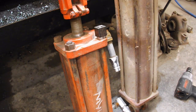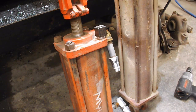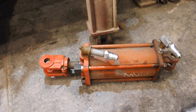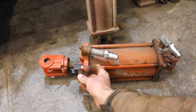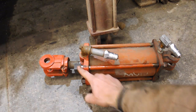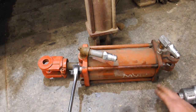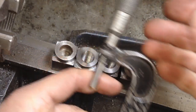I don't know if it's obvious or not, but I better say it real quick. The way this works: I set the tie rod to where it was just the length — a little bit past the nut, just a couple threads sticking out past the nut — ran this nut down to that distance, put this on, and held it with the wrench, and hit it with a gun. Well, I actually wasn't going to tighten it again, but the rod turned a little bit on me. I need to torque that and make sure that's right. So I need to back that off — I don't want to break that ear off there.